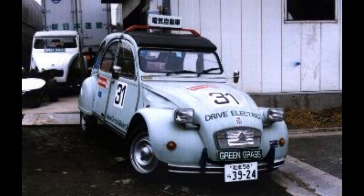The motor was 30 kilowatts, which is a really big, powerful and heavy motor, and it didn't have much in the way of batteries at all. So I thought I'd have done it differently - I would have put probably a less powerful motor in but more batteries to give it a much better range. So what I want to talk about today is what I did with my electric 2CV.